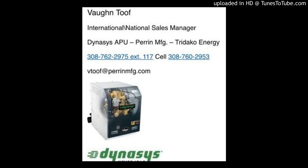Now, how long does it take to actually install these units? I always tell everybody a day and a half. We take a full day — sometimes we have to move the tanks forward if they don't have the 18-and-a-half frame rail space, sometimes we have to remove skirting. Why I say a day and a half is we get it all buttoned up in a day, bring the driver back in, go over everything with the driver the next day, show them how the cabin control unit works, how to check the oil. He doesn't leave our shop until he knows everything inside and out.